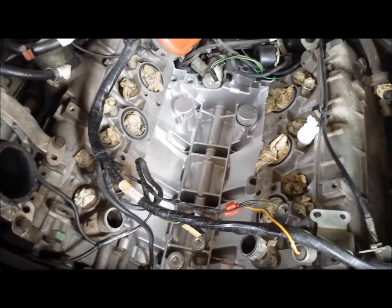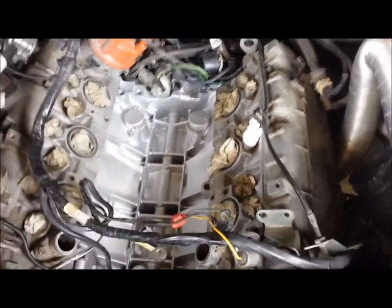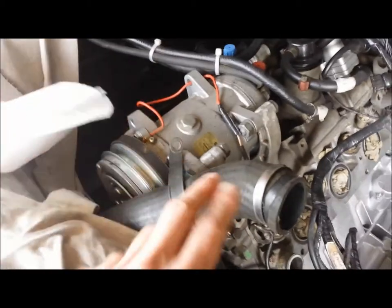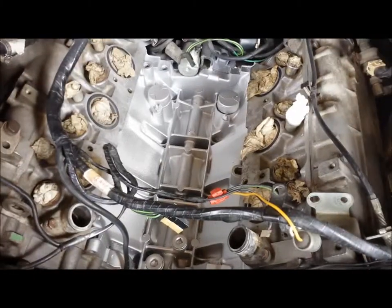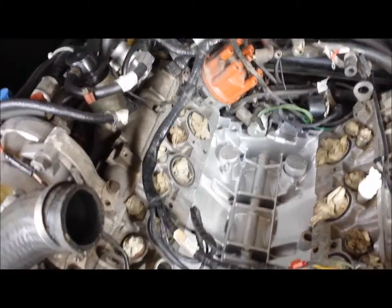Next task — I've taken apart quite a few things and sprayed them up, as you might be seeing in the pictures. I'm going to get these valve covers off now, which means I'm going to have to shift this compressor out of the way, and also the control pressure regulator, which is just there in the silver. I'll take some photographs of all this to remind me, then get those taken off and cover that up to make sure nothing falls down into there — and then load more stuff off the engine.